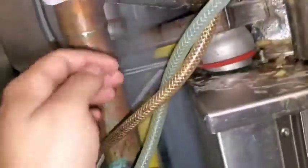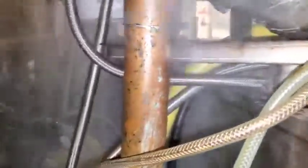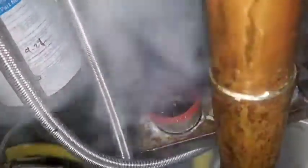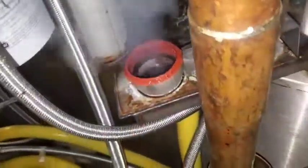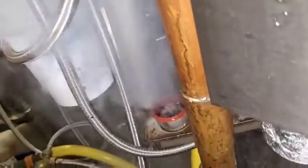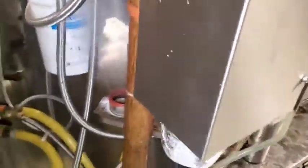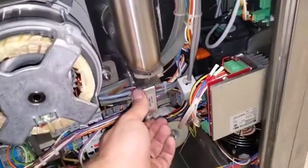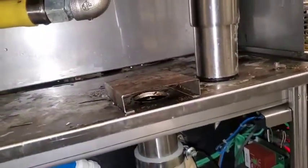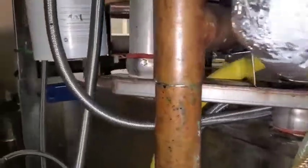It's supposed to be the vent for this oven. That vent's full of water — pretty much no doubt. Look at how it's sitting level like that. That'll be the reason it doesn't vent correctly. That's ridiculous. So I just tilted that little thing and let the water drain back into the oven. And now it's venting. Open this intake — no steam comes out. So I've got the vent bank sorted. Let's slope towards the oven.